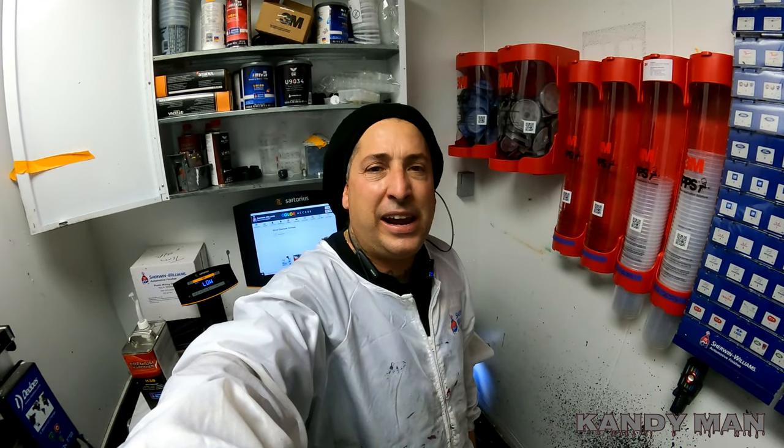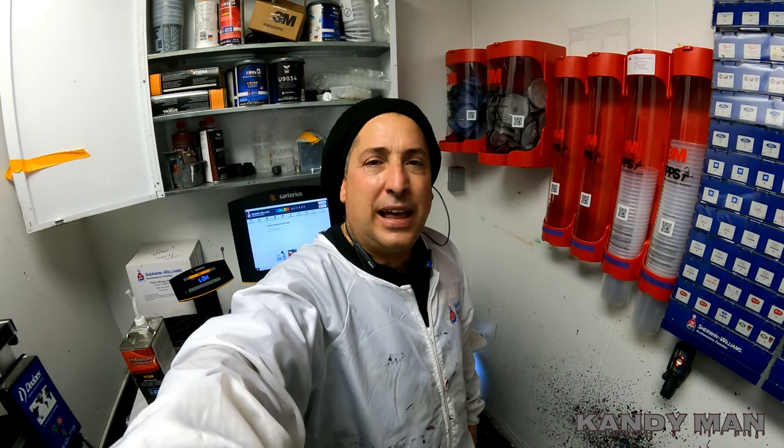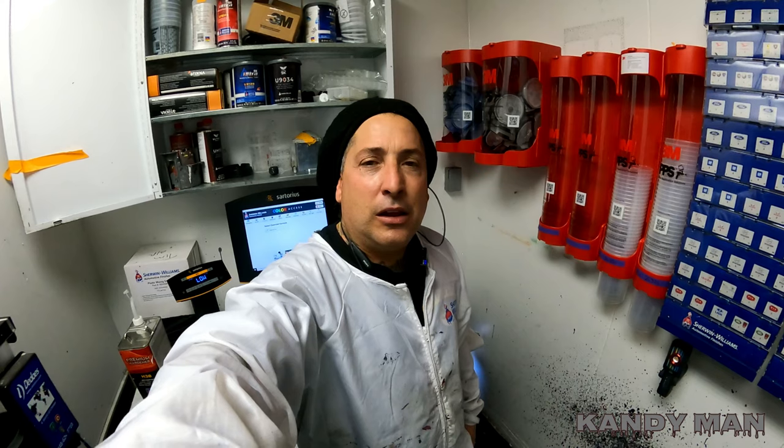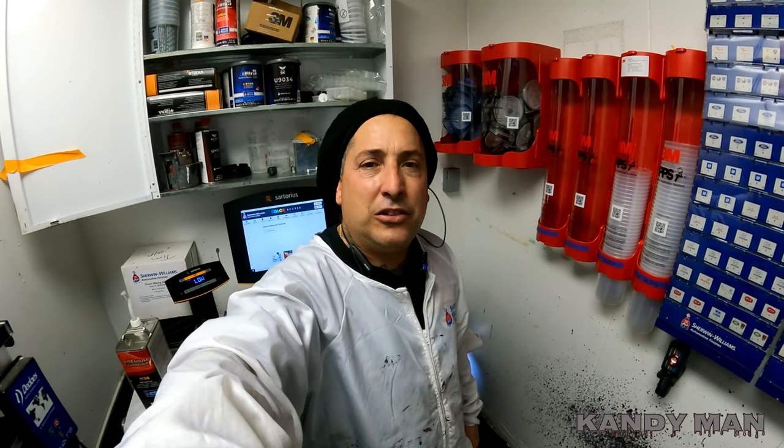I'm going to spray this one at 18 PSI with the C2 cap, and I'll show you how you can lay it out with less pressure. A lot of that has to do with the clear thickness and how fast it kicks, and all those things are variables in how this job is going to come out.